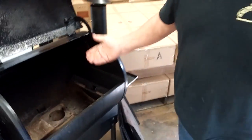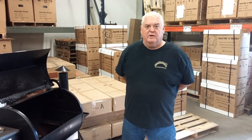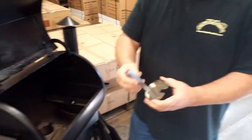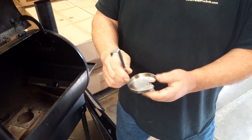And after two or three times, if you want to do a major clean, you can bring your shop vac out and do that. But that's a quick, easy way to clean out your burn pot. It's a nice little device and it's all stainless steel and should last for quite some time.